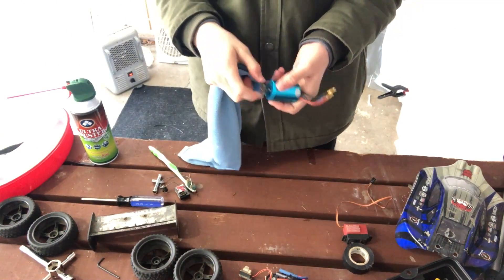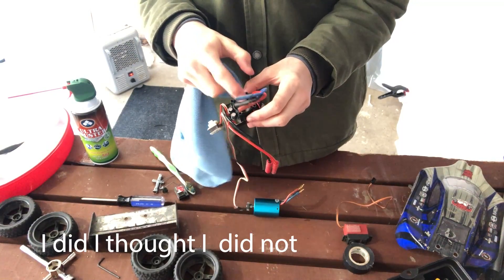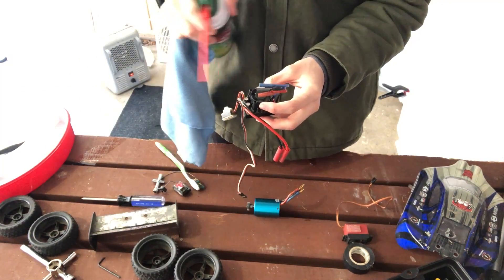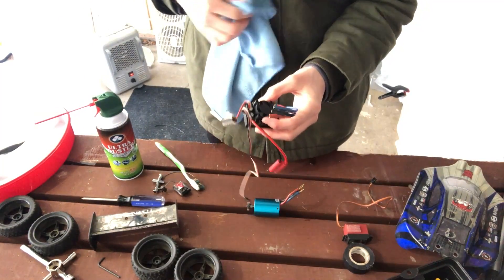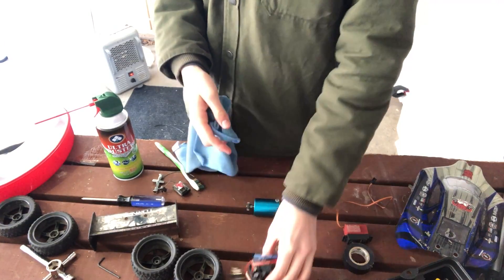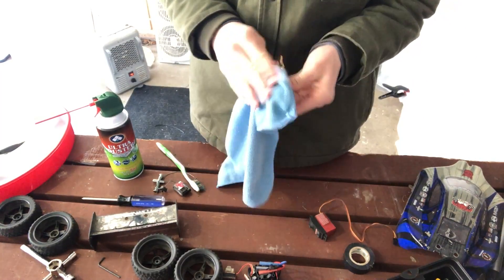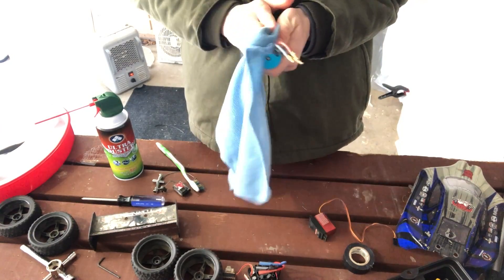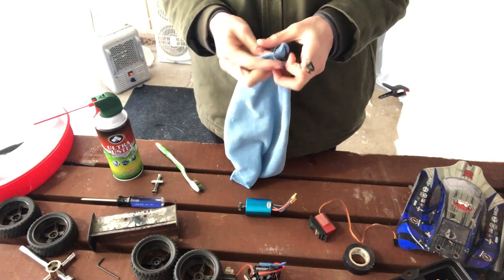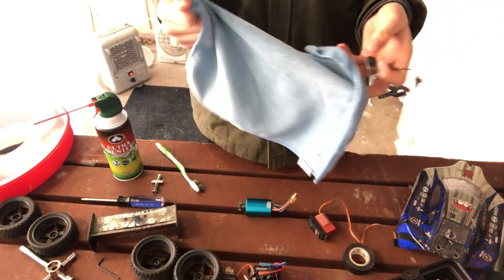I hope I caught all that footage — I don't know what my phone was doing. I was cleaning all of this out with water, using my air can, taking the fan out and cleaning it with a toothbrush inside because there was a bunch of debris in there. I also cleaned off the servo and I'm doing the motor right now. Sorry if you guys didn't see that part. This ESC is the main part that died — I'm gonna have to repair it until I can find my other one. I can't drive too far away because it tends to start losing signal.